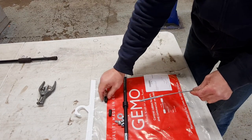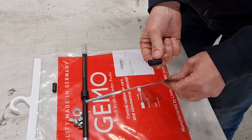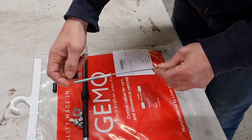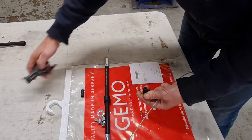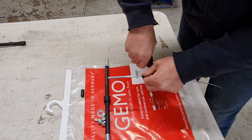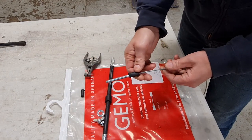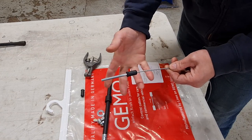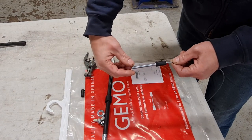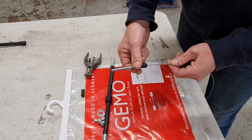Our next job is to fit one of our rubber grommets to our cable. The grommet needs to go the correct way around — on the bus it fits into the tube that way, and our cable passes through it that way. So we need to get that very small hole up and over the stud and onto our cable. I'm going to do that with the use of this tool here — I push it on like so and that allows me to open up the grommet and fit it. If you haven't got that tool, a little trick is to warm the grommet up in water first to make it more pliable, then use a pencil with the rubber removed from the end, push that end over the stud and slide the grommet up over the pencil onto the stud with a bit of grease, and then into position.